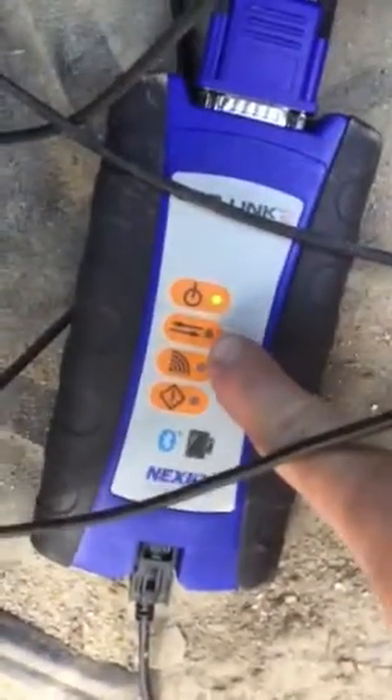We have no check engine or stop engine light, and I also do not hear the lift pump run when I turn the key on. I tried to connect to InSight and it won't establish communication — you can see my USB link is powered but I don't have communication. It comes back as 'cannot communicate.'